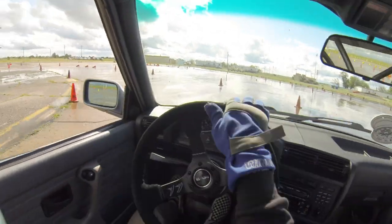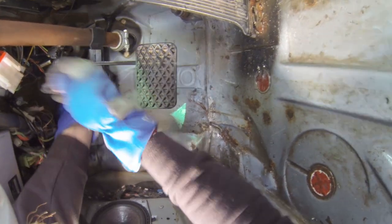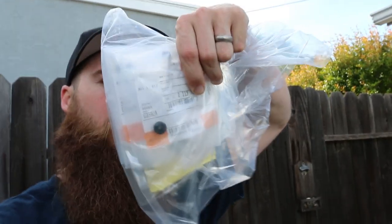Oh shit! I don't have a throttle - just give me a zip tie. It just kind of popped off. I knew that I had bad bushings - not even bad bushings but literally no bushings on the accelerator cable area. So I went ahead and ordered some of those - all little grommets and bushings from BMW, about $27.